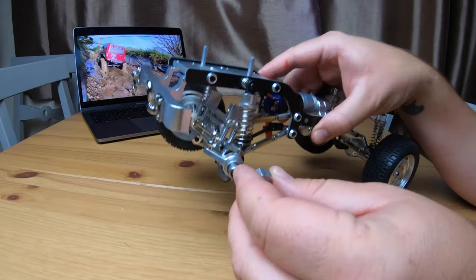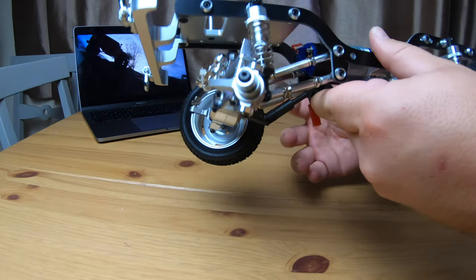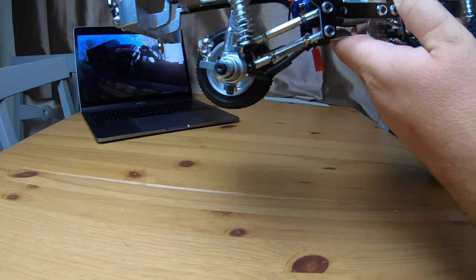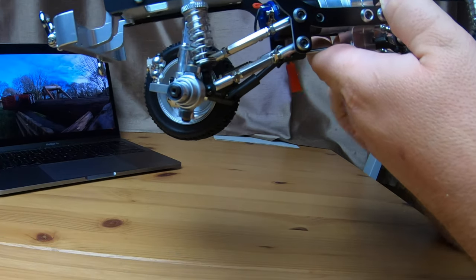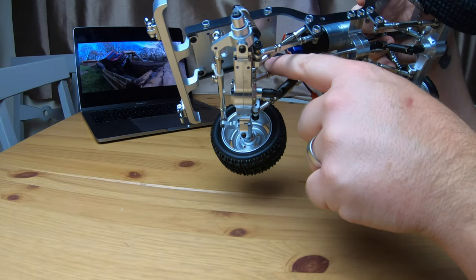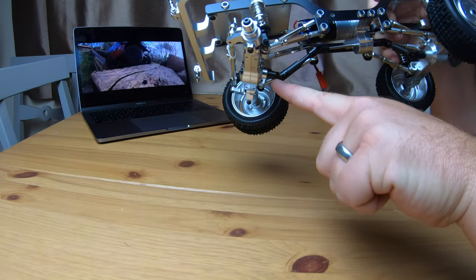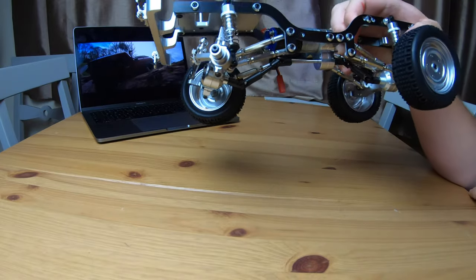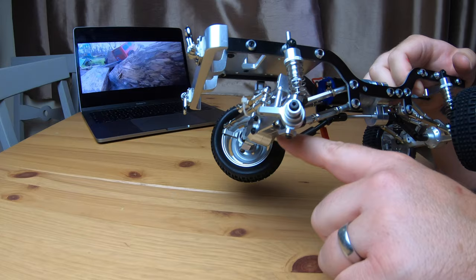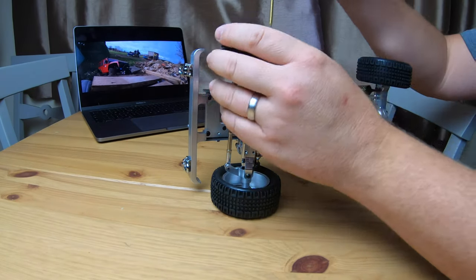There's a 12mm adapter that slides over the axle. Can you see the angle of that front axle? It's actually pointing down. What you want is for it to be pointing up slightly. All it means is these top links are too short — they need lengthening. That will push the top of the axle forward, bring your driveshaft angle up, which will be much smoother. One easy way to check that angle when running is if it feels like it's jumping or skipping — it's usually that angle that's wrong. I'll adjust this before we get it running.